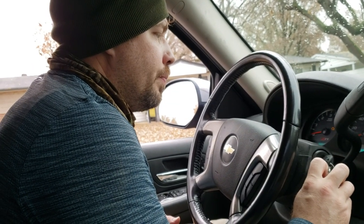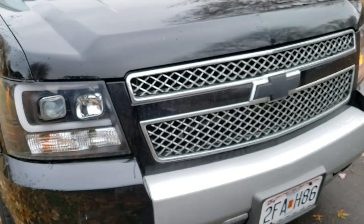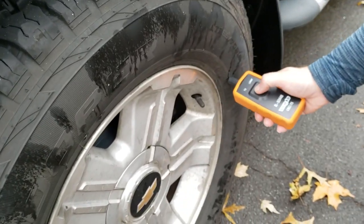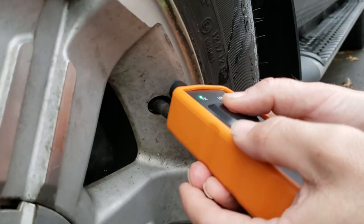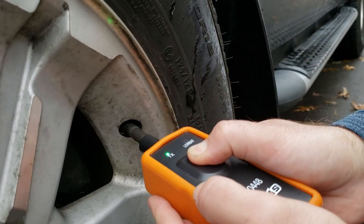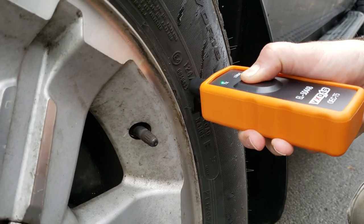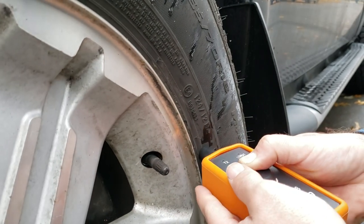So it's a tire monitor system and we're on tire learning. You need to go from this tire to that tire — come on around. The light is on; it lights up the side of the car that you need to go sensor. So you want to find the tire's valve stem and hold the tool there. And guess what — it's going to tell me my TPMS is bad. My actual TPMS in there is bad because we're not getting any reading.